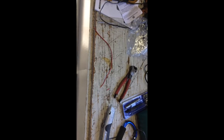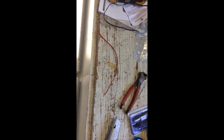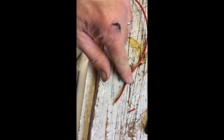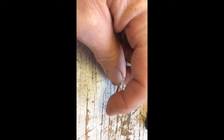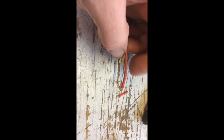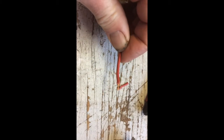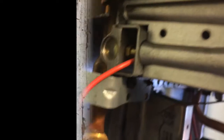This is the special tool that will allow you to clean out your orifices without having to take the whole heating element apart. The gas burner should be able to stay in place while you use this wire. I've cut the end of it off and frayed those individual wire strands slightly so that when I feed it through the orifice, it will pick up and pull out any spider webs that are in there.